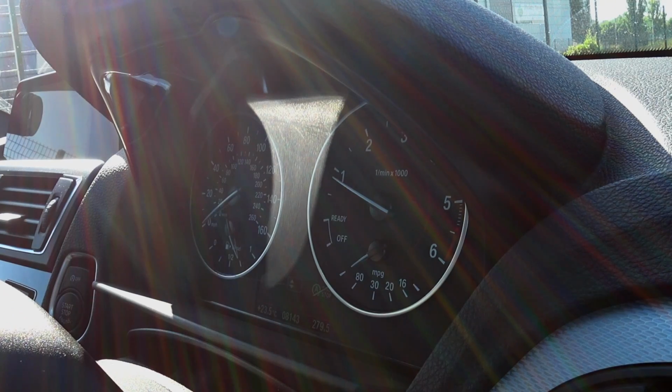And all that happens in a car without these anti-stall measures, if you like, is that when you lift the clutch to the bite, the engine's got this load on it and it's trying to work and it's trying to move the car away, but there's not enough power to do that. And it's pushing the engine lower than it actually wants to work at. Where it is at the moment is what we call idle speed. It's the lowest speed that the engine wants to work at. And when you move away with just the clutch pedal, the car's always pushing towards a stall.